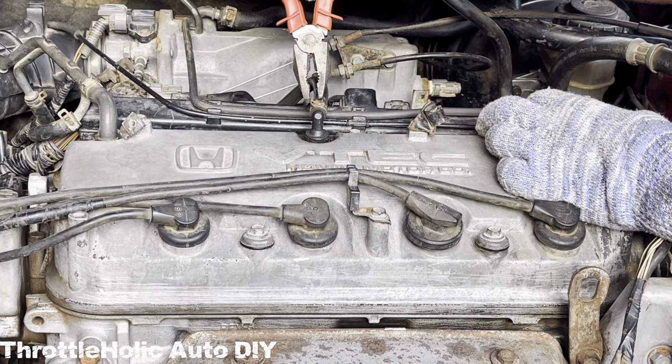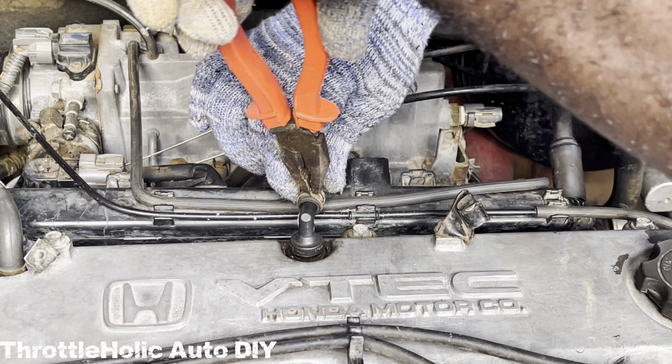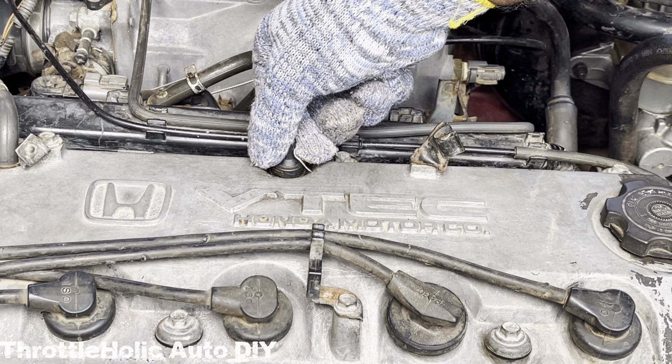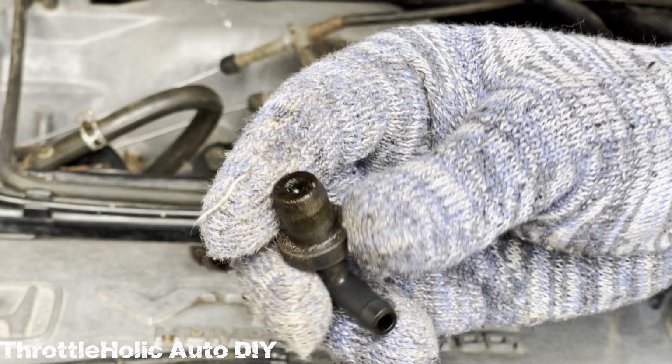With the clamp still firmly squeezed, use your free hand to gently but firmly pull back the hose that connects to the PCV valve. This will present a little resistance, but when done gently and persistently, the hose will eventually give way and free the valve itself. With the connecting hose out of the way, gently turn the PCV valve counterclockwise and firmly up. It should come out easy and without any sort of drama whatsoever. It is at this point that you will determine if you are going to service or replace it.